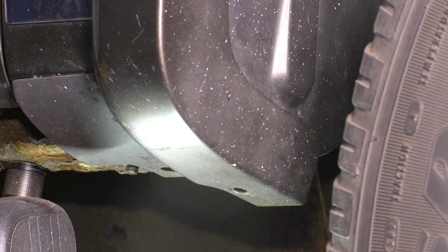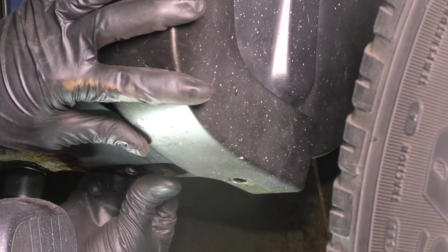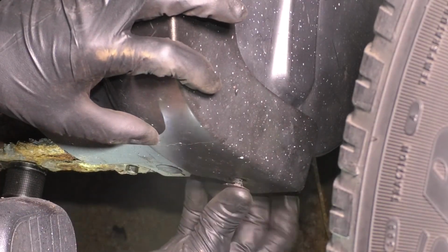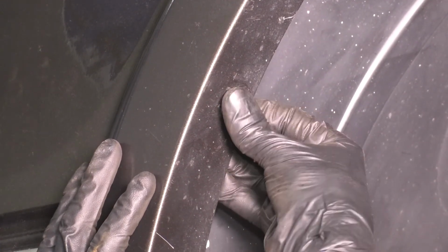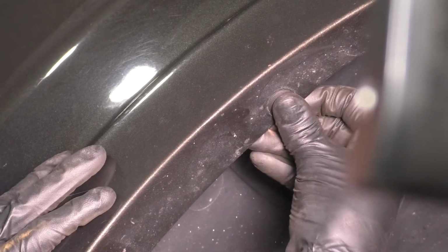At the bottom there will be two push clips to be reinstalled, one over here and then one right over here. Okay, and another one, if you follow the fender flare up, resecure this one and keep going even further, and you'll see that one right over there. All right, now let's put back the mounting screws on the side here.